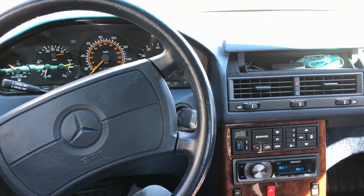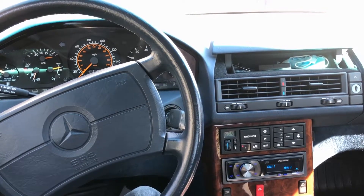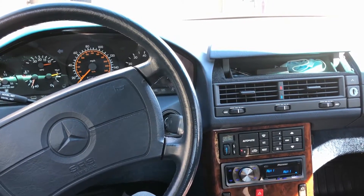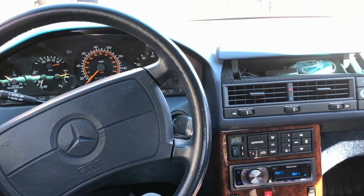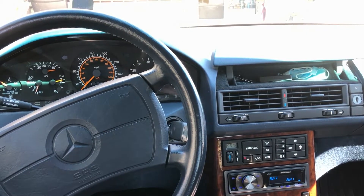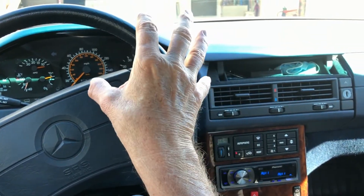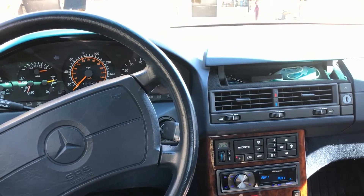I ordered some new ones. If you have cold start issues with your SL, try taking the air filters off and see what happens. I take pretty good care of this car and it's fairly low mileage — 38,000 miles. Try taking the air cleaners off and see if it starts. If it does, then you know you've got bad or dirty air cleaners. The air cleaner box is sealed really well — they did a good job making sure all the incoming air is directed through the filters. So that's what it was — let's take it for a quick test drive.